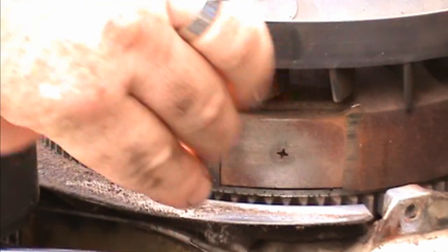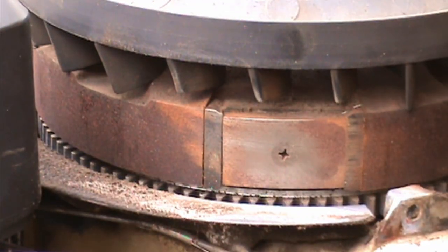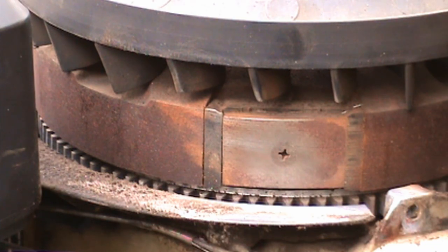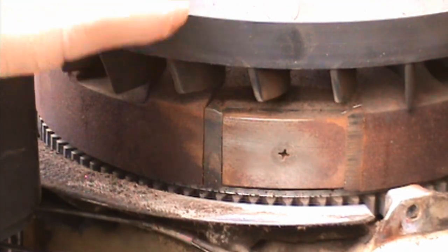You'll see it's starting to shine up. With that, you have better contact — a lot less resistance — so you've got a much better chance of getting your spark. This was just a mini overview of what to look out for on your normal everyday lawnmowers, and this also works on chainsaws and weed whackers, as they have the same armature and magnet configuration.